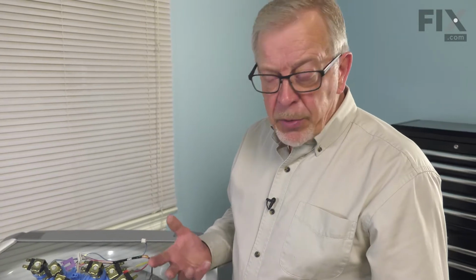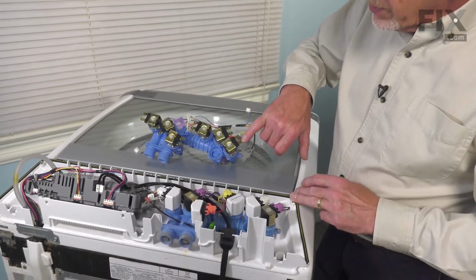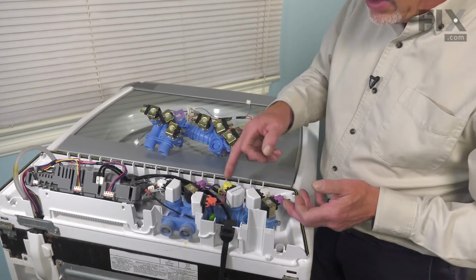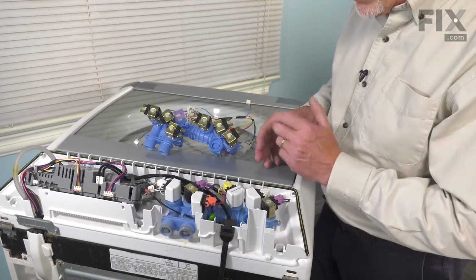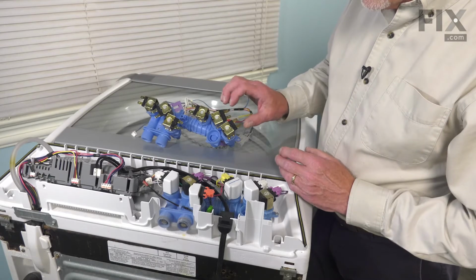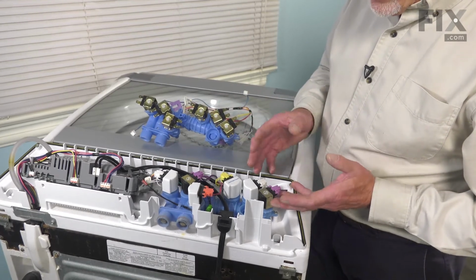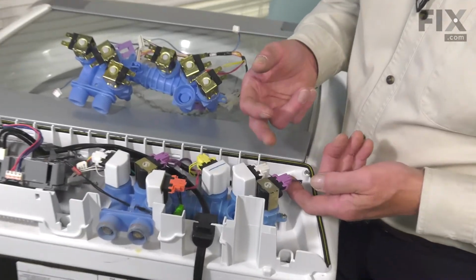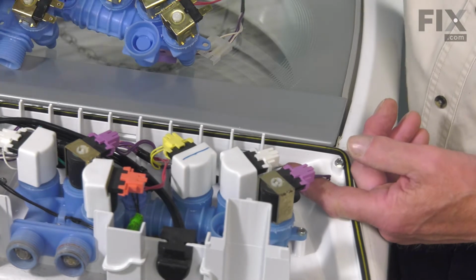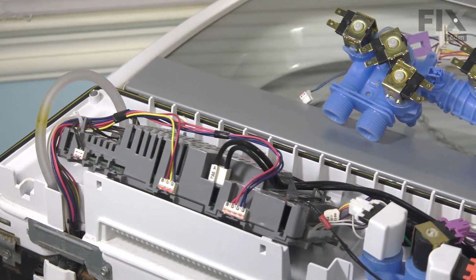Now, if the valve that you're replacing has the standard 1/4" spade type terminals on it, we simply need to disconnect each of the individual harnesses, fold them out of the way, replace the valve, and then reinstall to the solenoids on the new valve. If your existing valve is similar to this, it uses the smaller type connectors, you'll want to remove that harness from the end points and remove the whole valve as an assembly.